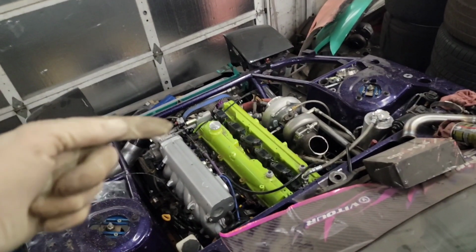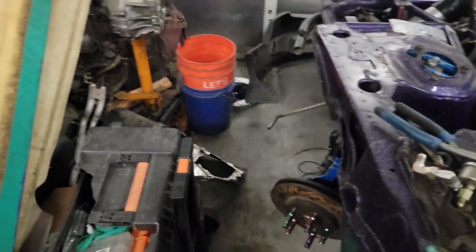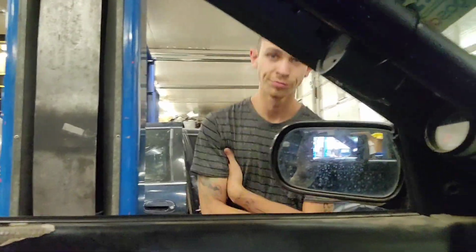So I took it home, repinned it, did a pin test from every single pin on the wire connector to the ECU, and verified everything, wrote it all down. I got myself a fancy little chart, what goes where, and now the moment of truth. Kelly helped me plug the engine wiring harness up to the engine itself.